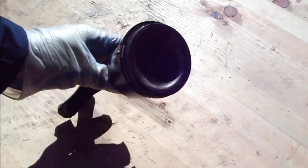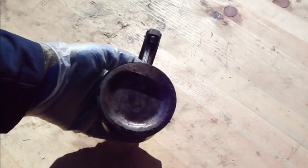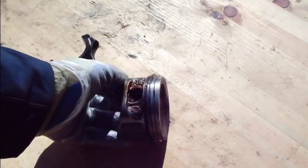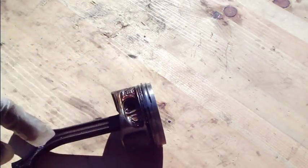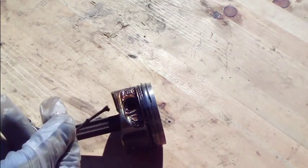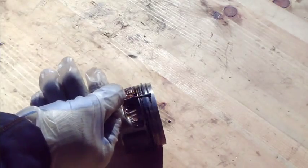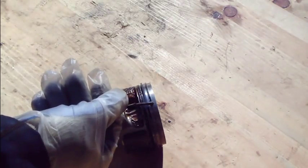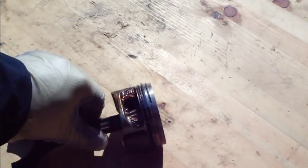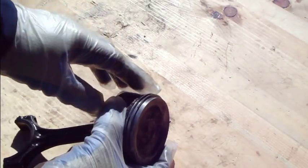When I start to take these piston rings out, there are many ways, but the best way is that we don't destroy the rings. The ring opening always starts at a specific point — I use a very small stick to first locate the hole where the piston ring ends and starts. This gap is the key starting point when we take the piston rings out.